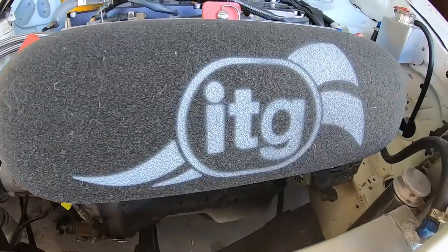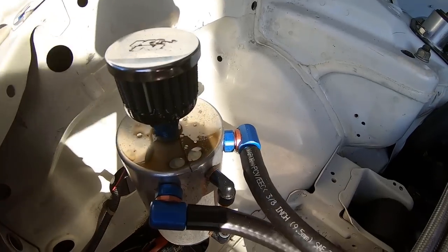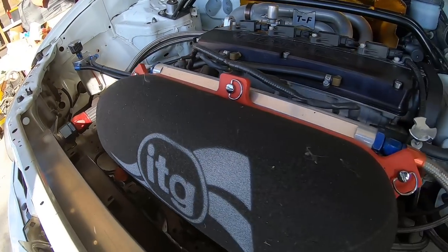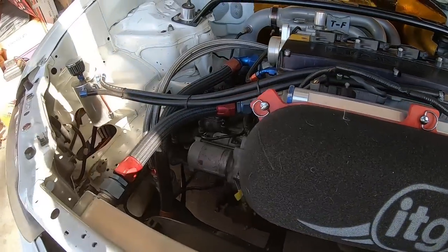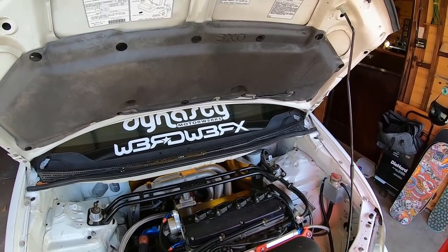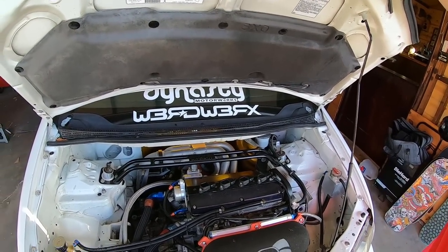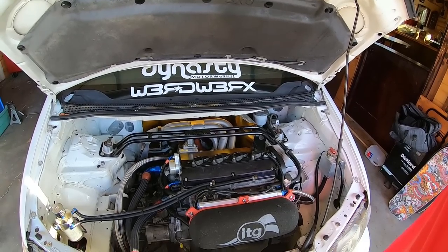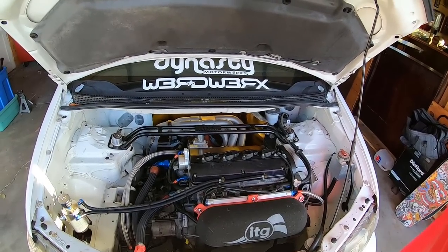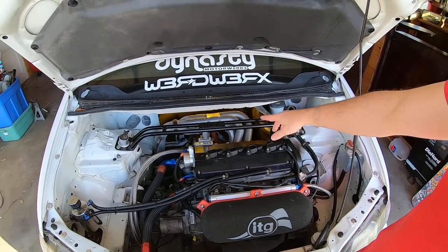Because this doesn't have any accommodations for a cam breather, I had to put one in — so it's a little filthy right now because of some blow-by; the rings are shot and it's ready for a rebuild. The valve cover is cool — this is the original valve cover off a British super touring Accord. I got it from the guys who made the head gasket at Neil Brown Engineering in England. They had one left and I think they quoted me $600 — I said sold. The head gaskets for this reverse cylinder head are also made by Neil Brown Engineering, and to get one over here you're looking at about $400 plus $150 for shipping.